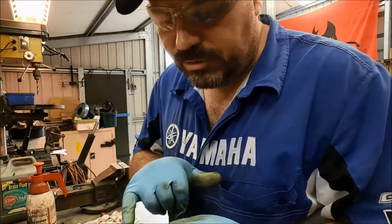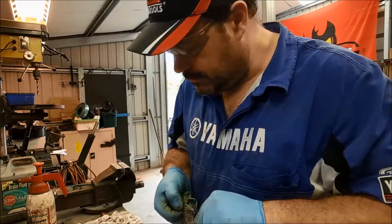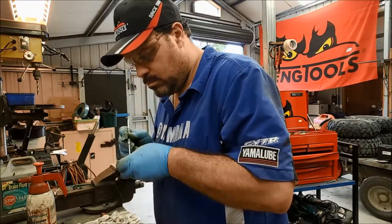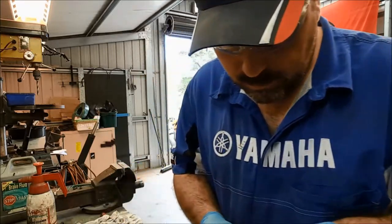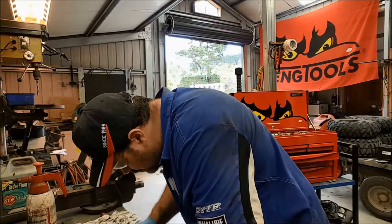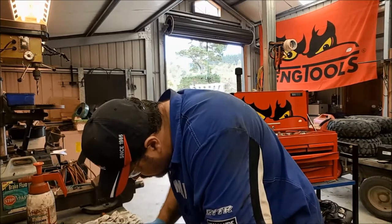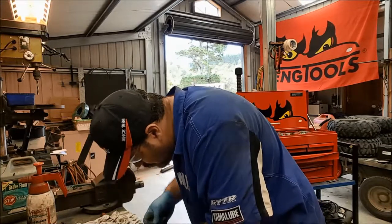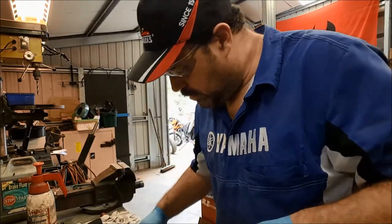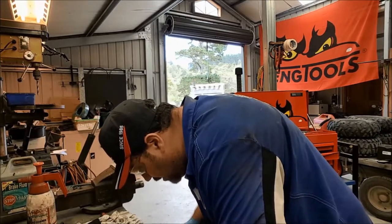Now, the other one's different. Both the two pistons are in contact with the anti-rattle shim. So what we'll do is flick that off, and put a little bit of copper paste behind it. There we go. Also a bit rusty as well, so we'll give it a bit of a sand. Get rid of all that rust. Rust is bad. There we go. In fact, I think we'll even file it. Yeah, there's some rust blobs and that's going to affect the whole thing sitting squarely.